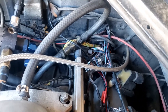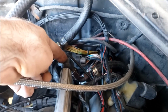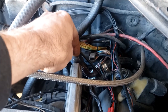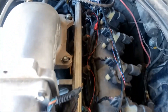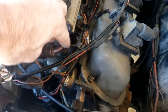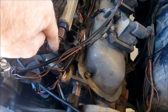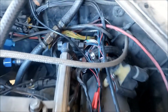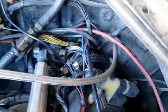I have a fitting coming that will allow me to replace this with a three-eighth pipe to AN6 with an eighth-inch tap in the top, so I can rearrange this stuff and feed into the back with the pressure sensor sticking straight up or out to the side. The other option is a little adapter that threads onto the AN6 with a short piece for the eighth-inch pressure sensor port and an AN6 nipple. I'm still debating — I might also extend it around the other end, but I need to figure out a different way for this hose to connect to the fuel system.